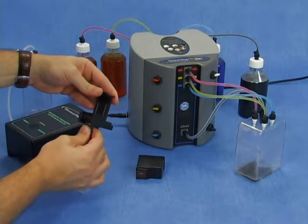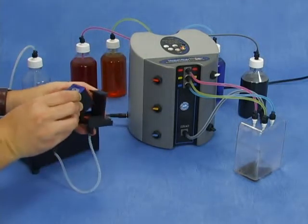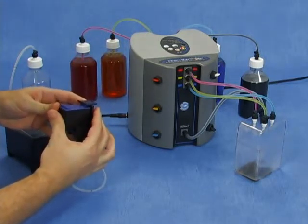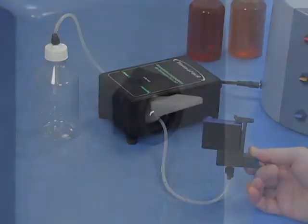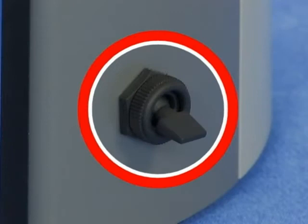With ACD installed, fit the cartridge at its respective adapter and the adapter to the ACD connector labeled as cartridge. During this step, independent of the cartridge's model, keep the printhead always turned downwards. The white key should be lifted upwards, and be careful, do not forget to leave the black key turned downwards.